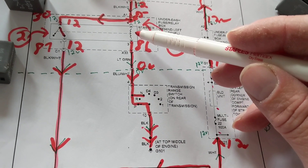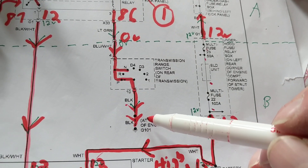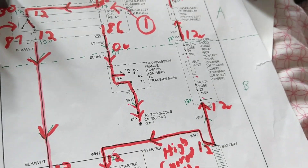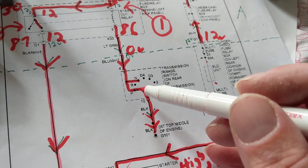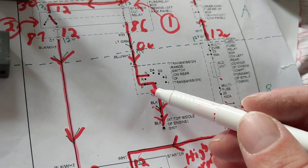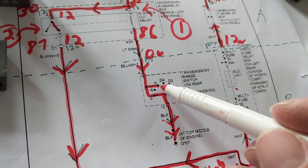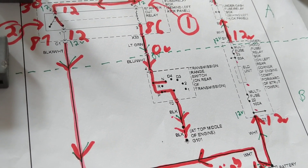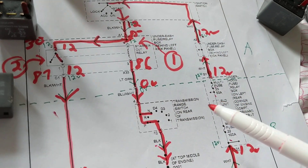What we're left with is: is it a relay problem, or is it a park/neutral safety switch problem? How can we know? Take the gear selector and put it in neutral. You have two positions — park (the default) or neutral. If the engine comes on in neutral, we know we have a problem with the park/neutral safety switch. If it doesn't come on in either position, then we're dealing with other problems.